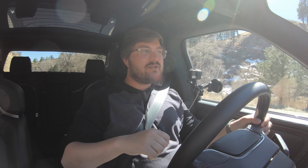Okay, so what that knock is basically, I'm not sure if it's the motors rocking on their mounts or if it's the half shafts, the axles rocking within the motors, but you do experience this at low speed, backing in and out basically of a corner. So high state of charge will always give you more power. We're at 70%, that's plenty to give us pretty good juice here. The motors sound super healthy. I believe they're Bosch sourced motors. They're not built in-house, but they're optimized in-house and it's really good.